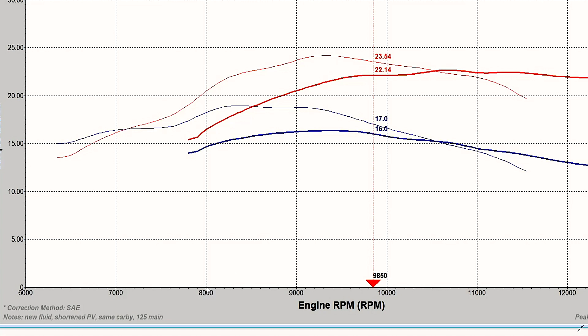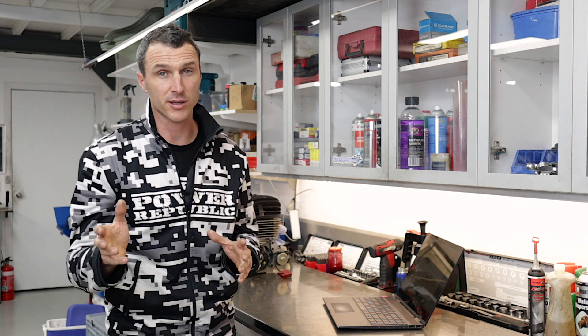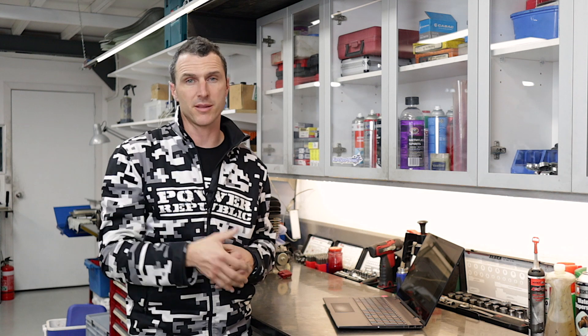You can see the X30's RPM starts at 8,000 — it's got a lot more mid-range and top-end, so you want to get up there earlier. At our local track we run a 10/80 gear ratio on the X30, whereas on the Rotax we'll use an 11/80, so we're going to rev the X30 a lot harder. That's mostly because of the divergence in torque from 10,500 RPM all the way up to the 15,000 RPM redline, where the X30 has more power.